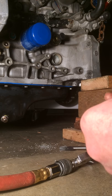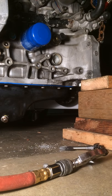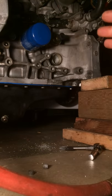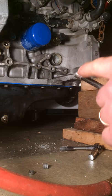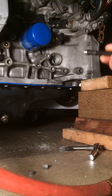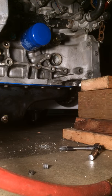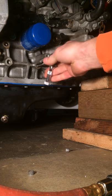It's not too bad once you've done it. When somebody gives you something like this and says they need you to work on it, and then you find out you've got stripped holes — well, that can really add time. The idea is to get your tapped hole cleaned out very, very well, because you've got to put your insert in there and you don't want any material that's going to foul it up or distort it when you go in. This is a one shot, one kill kind of deal. If you don't get it in there correct, you're pulling it back out and doing it all over again.